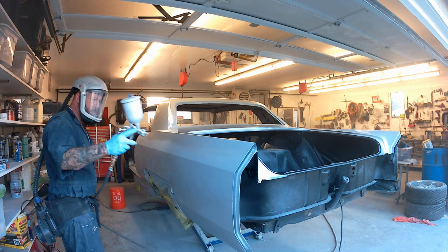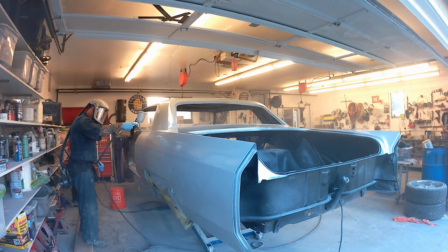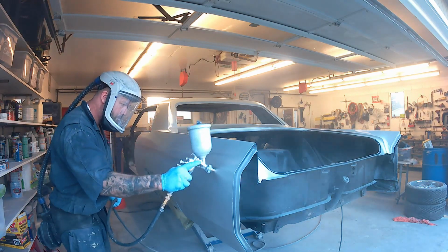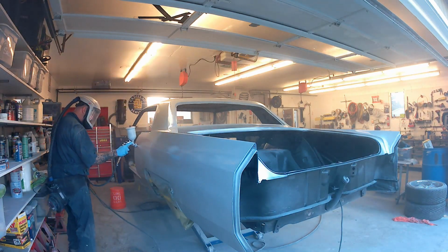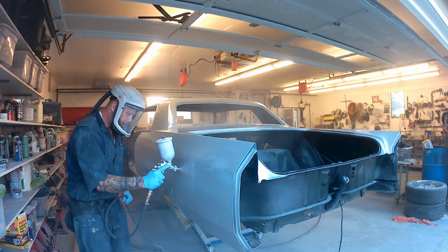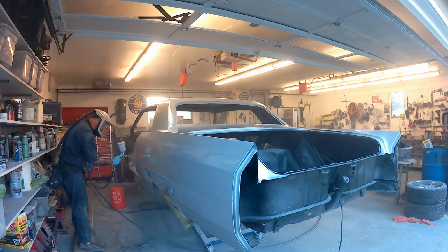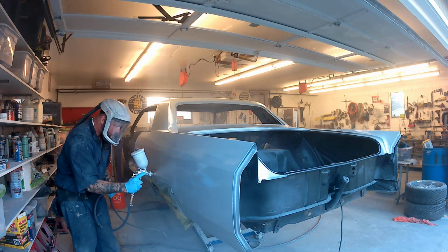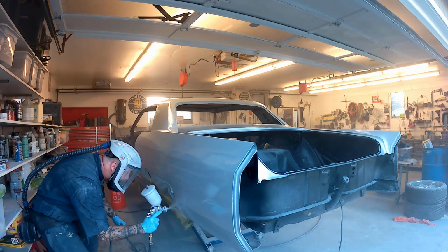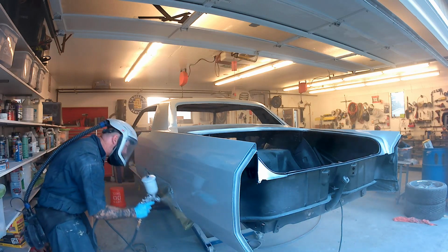Let's say, just for shits and giggles, and this is not realistic, you're putting it on, and feather fill is 1/16 of an inch. Then your slick sand would go down and not quite be 1/8 of an inch. It's probably 150% of the coverage of what you would get with the feather fill G2. So I don't know if it's that much difference. That's the higher cost, I guess, is the thickness in a gallon.